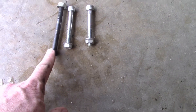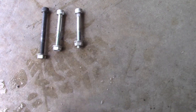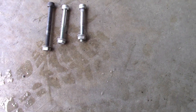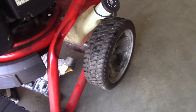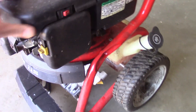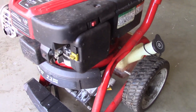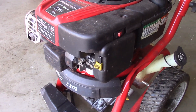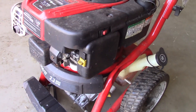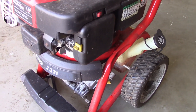There are the three nuts that came out — two of the three are identical, and the longer rusty one goes like this. So that's three bolts and three nuts. It turns out the pump and the motor are kind of pinched together, so when the pump comes off the motor comes off too — I didn't know that beforehand. So I got everything loose so I could turn it, then lifted the unit back up and removed the rest of the screws from the bottom, which gets a little painful but it can be done.